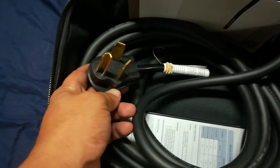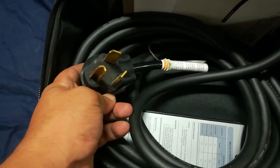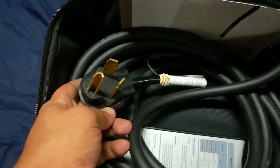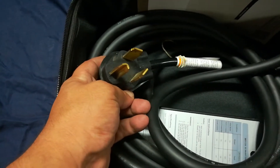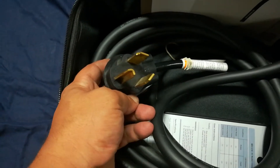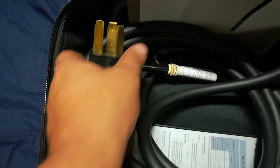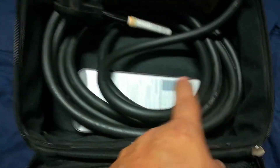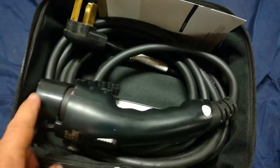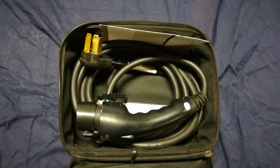At the dealer, the same thing — I didn't want to install anything major or invest a lot of money, but I wanted something that charged the cars in case the customer was driving home that day and couldn't wait for the regular 110 or 120-volt charger to top the battery off. This is cool because it just uses a regular dryer plug and comes with a pretty lengthy cord.